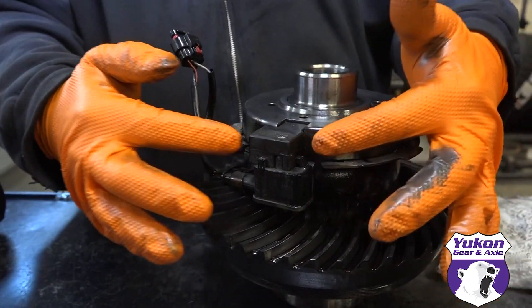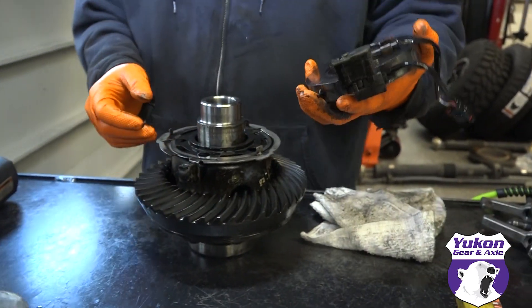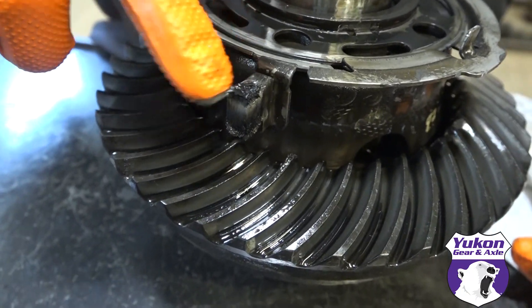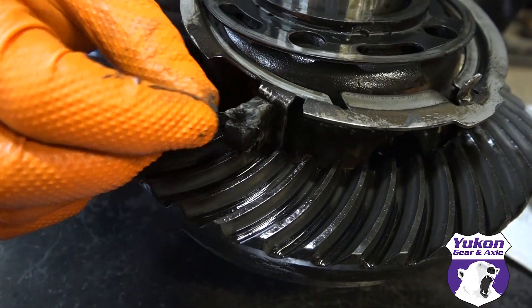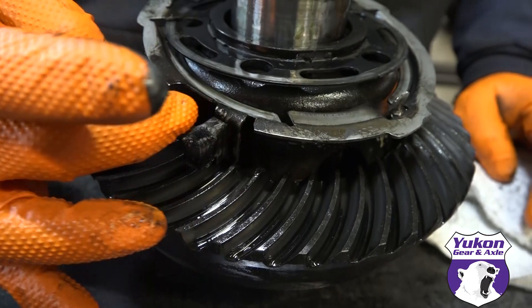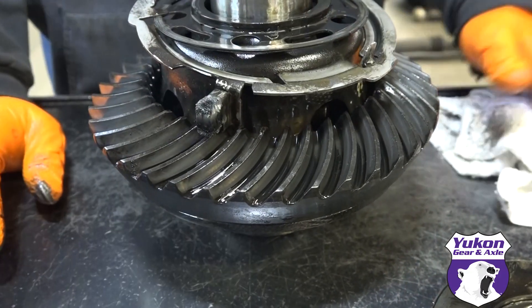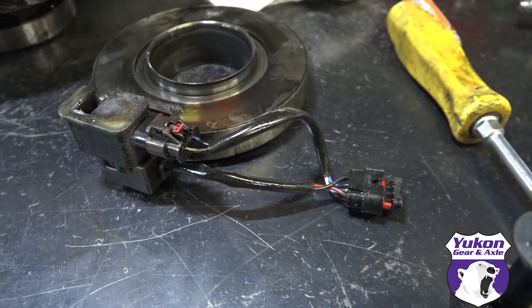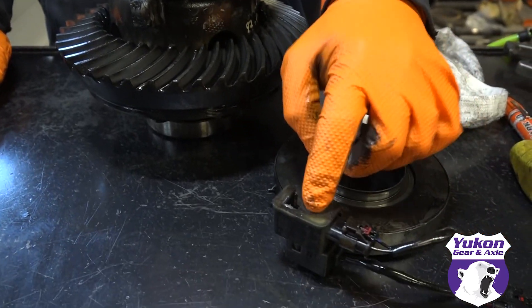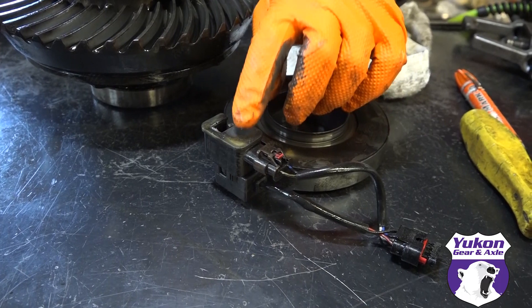One of the things I notice really fast when we get this apart is this sensor is magnetic, and if you see right here, it's completely covered in fuzz and oil. These are all the little fragments that go around in your gear oil, and these fragments right here could be causing an issue with the sensor. Since nobody's actually fixing the sensor, we're not 100% sure if that's the cause of why the sensor is going bad. Basically you've got this ring moving up and down inside the sensor. It could just be that this sensor is a bad design — these differentials are still pretty early in their generation.